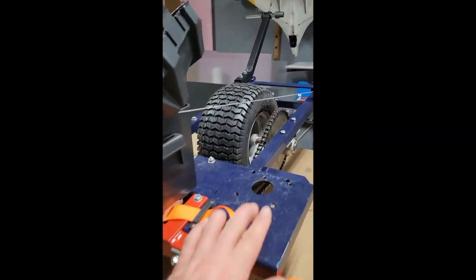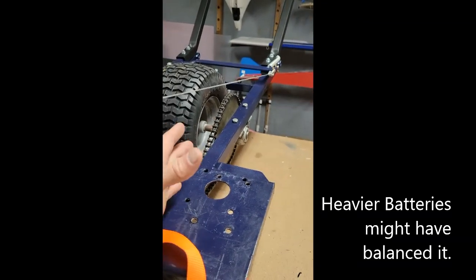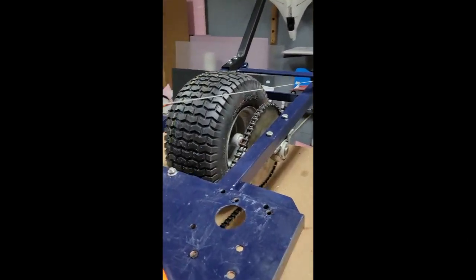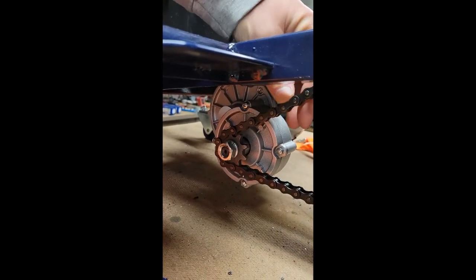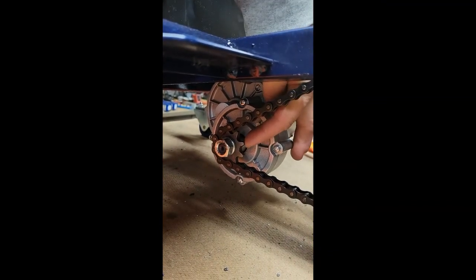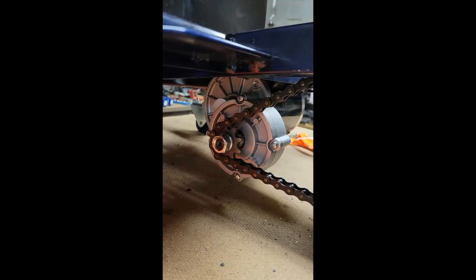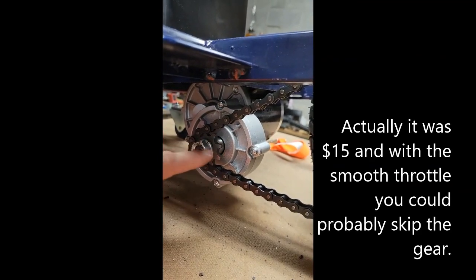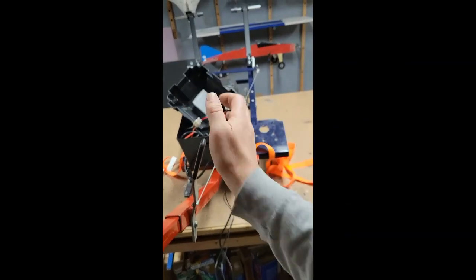You'll notice the motor has moved. When I picked it up it was extremely off-balance because I had the motor where the old gearbox was — lined up great bolted, but when lifted to a driving position it was far off-weighted to the right. So I ended up moving it underneath. This is a 450-watt geared motor from electricscooterparts.com using number 41 chain. I swapped the sprocket from a 10-tooth to a 9-tooth; the original was about 7-tooth and the big gear is 48-tooth, so I wanted to get as close to the original gear ratio as possible.